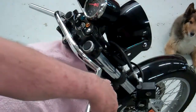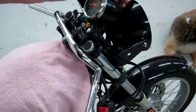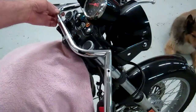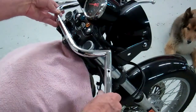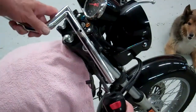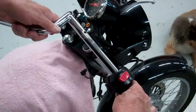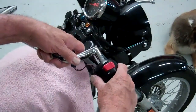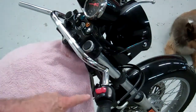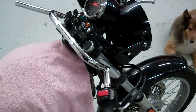Before we mount our bar, we need to slide the throttle housing over the end of the bar. I'm going to take the brake hose and just swing it out of the way. The bar goes on the bike with this U-shape forward. Take the throttle housing — the screws are loose on the clamshell so you can slide that over the bar. You may have to work it back and forth to get it over the clamshell. Then we can set that on the bike — that's impossible to get on after the bar is bolted on.